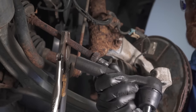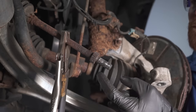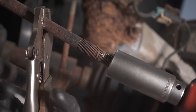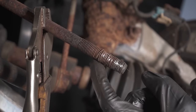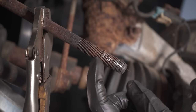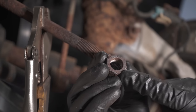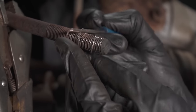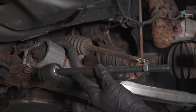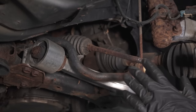Let's go with the assumption you are only going to be replacing the outer tie rod end without the inner. We'll assume the threads looked okay — obviously these don't, but we'll assume they do. There might be something underneath this jam nut you'd want to pay attention to. Underneath where that jam nut was, you can tell the threads are actually stripped and rotted in that area. Moisture can sit inside there, and this is exactly what it does. Looking at the threads on the inside of the nut, those are stripped as well. This is what holds everything together — just this one thing right here could cause an issue where you go off the road.